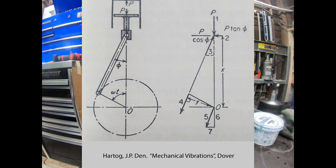The other forces: you have a force at the piston wrist pin at the top of the connecting rod, and the way this diagram is drawn, that force is acting to the right. At the other end of the connecting rod you have another force acting to the left. These four forces all have a primary and secondary component, and they all impose their own vibration against the engine.